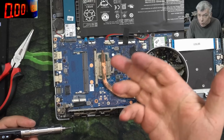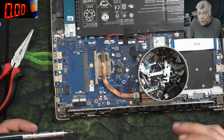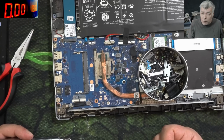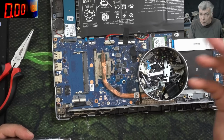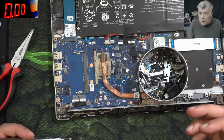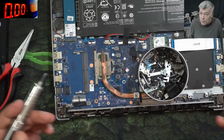Like overheating job and Windows cleanup. Another well-paid job. Before, in the shop, we were charging £60. I was using CCleaner for that job, taking the startup programs out, cleaning Windows, cleaning the disk, all temporary files and whatever, a lot of cleanup. Basically, it was taking like 15-20 minutes. But yeah, there are a lot of small services a computer business can make money from.